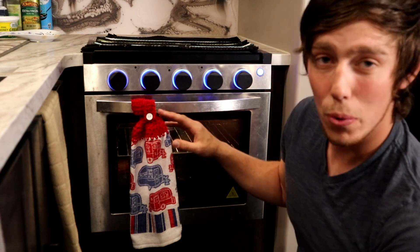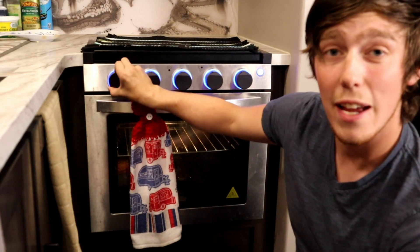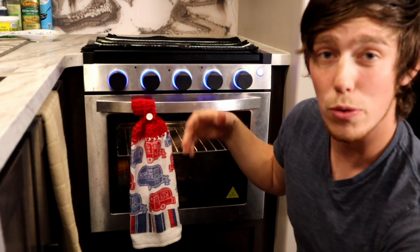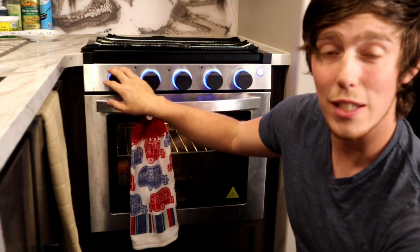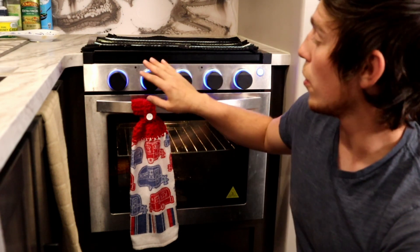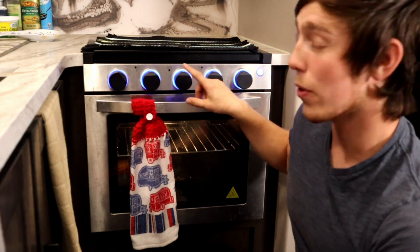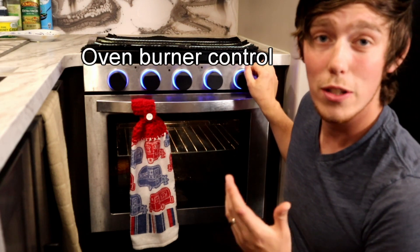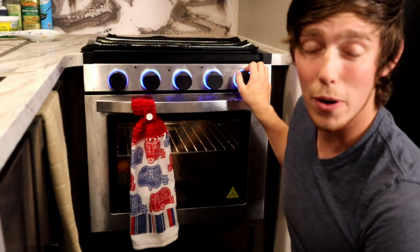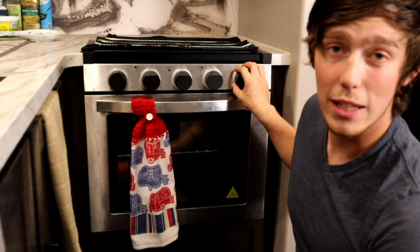We'll talk about the parts of your new oven and stove before showing you how to light them. Here are your main burners, and this is your spark — when you click it, it sends a spark to the burners as well as to the oven. There are three burner controls and then the oven control. Over here is the burner control that controls the temperature and propane flow in the oven. On many units there's also a small button that controls the interior light and the lights around the control knobs.